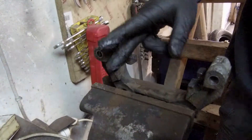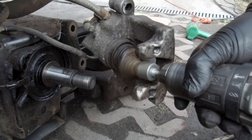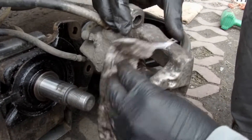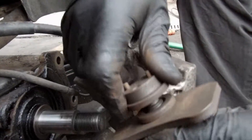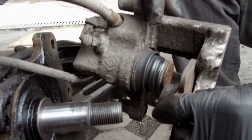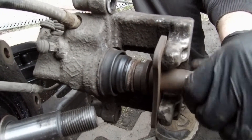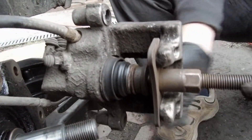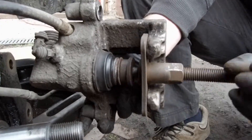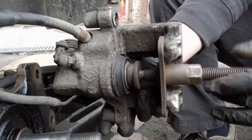Time to take care of the brake caliper. Check under the rubber dust cover how the piston looks — we are looking for any corrosion under the rubber. This one is okay. Remove all the acid brake dust, dirt and grime, as it can cause the caliper to seize. Also rubber seals and dust cover will last longer. So now we will use a brake piston compressor tool. This piston needs to be turned to compress. This tool is inexpensive so it's worth buying. This should feel nice and smooth all the way, which means everything is fine with the brake caliper. At the end it should feel difficult to turn — that means you've reached the end.